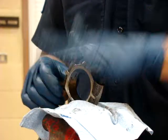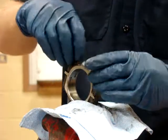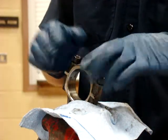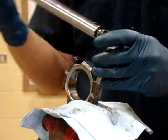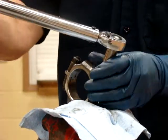So I'm going to install my cap onto my connecting rod and put my nuts on. In order to check this for out of round I'm going to need to torque my connecting rod cap into position. I've got my torque wrench set to the factory specification already, so I'll bring them down evenly and then listen for it to click.